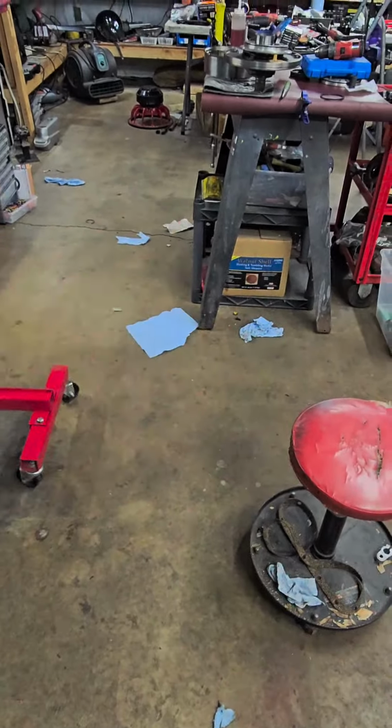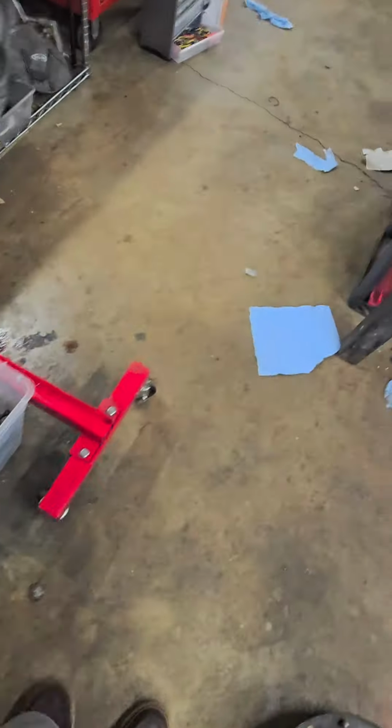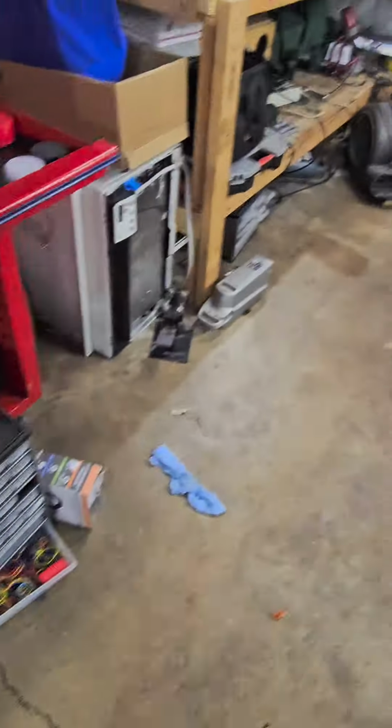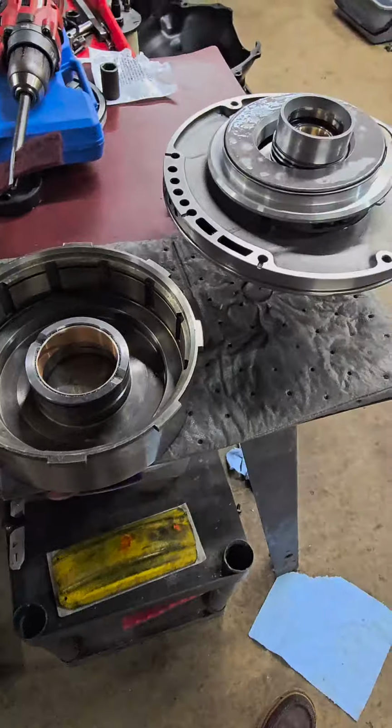And it turns out they eat the fuck out of the pump housing. So if you guys got billet pump gears, I suggest you pull them right out. I was having back-to-back failures, and I bitched them out. So bad. Anyway, we're gonna get this direct drum stacked up.